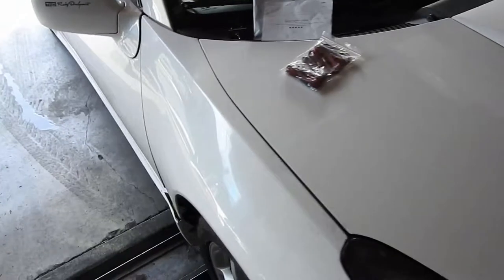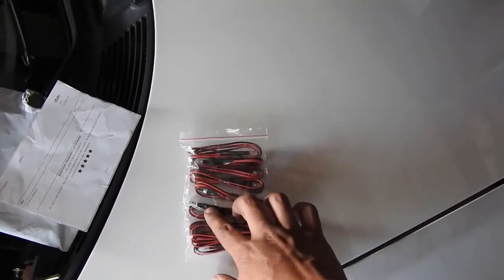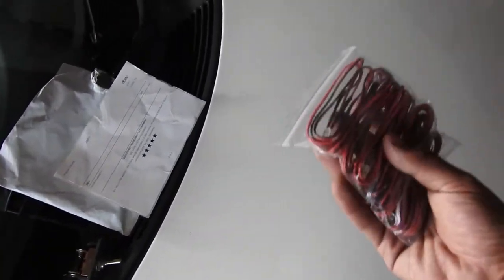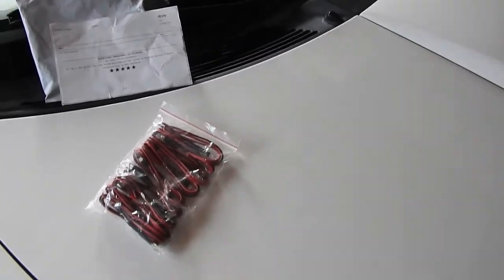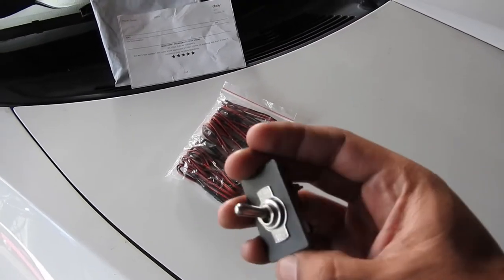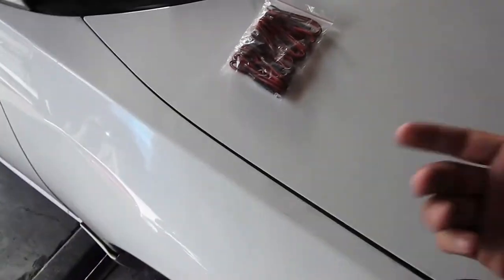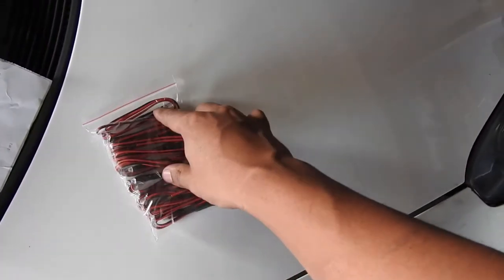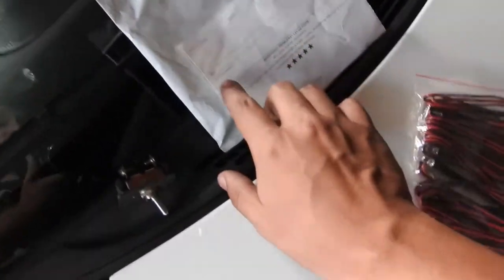Today, as you guys requested, I'm gonna put LEDs inside the air vents. I already bought them — these came with 10, with the wires already attached. It's a 12-volt system and they already have the resistors built in. You're gonna need some wire — you can use speaker wire, anything about the same thickness. You also gonna need a switch. My girl's using my old switch, the one I took off my Celica — just need a switch for on and off. You can buy these on eBay or Amazon.